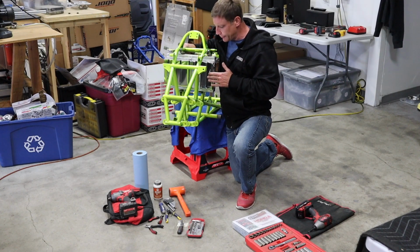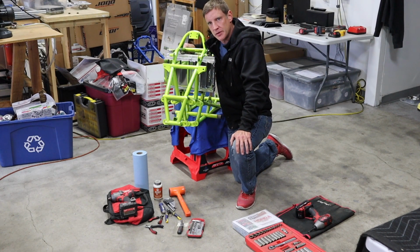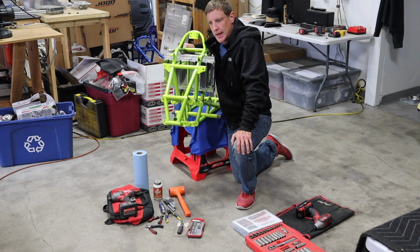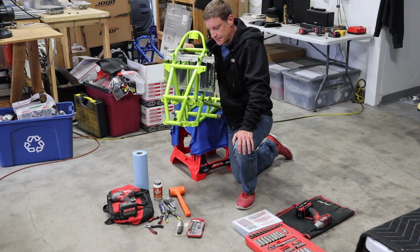Back to the louvers and the shrouds. So I use RTC shrouds and louvers on all my bikes. Brian Marion created them, and he's on Facebook. You could search him, Brian Marion, M-A-R-I-O-N. And he's been making these things forever. They've been well tested, and I really don't have any heat issues unless it's a brand new bore and I'm trying to break it in.